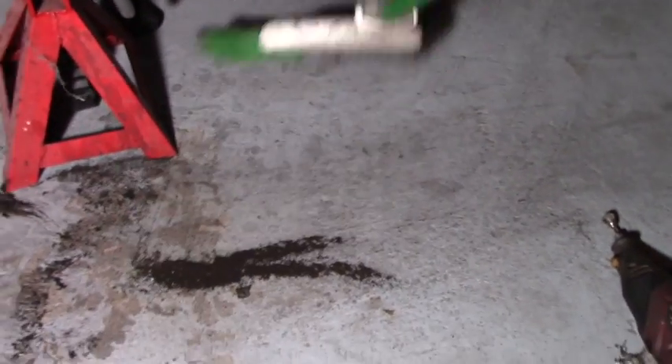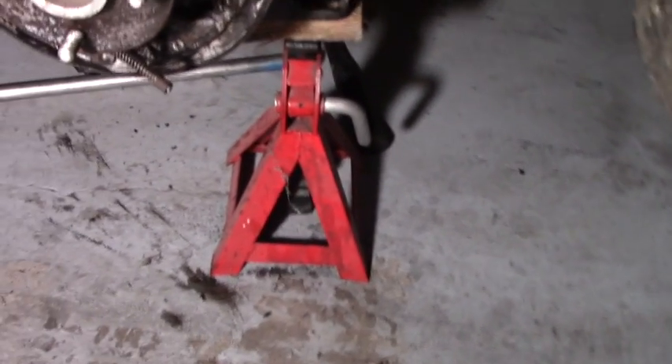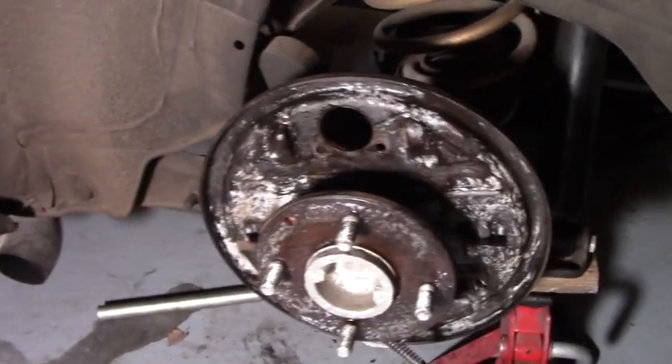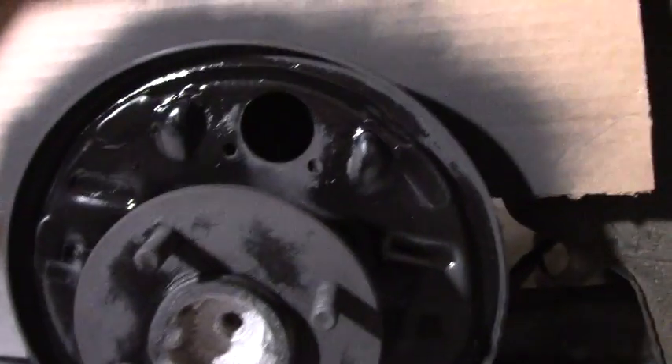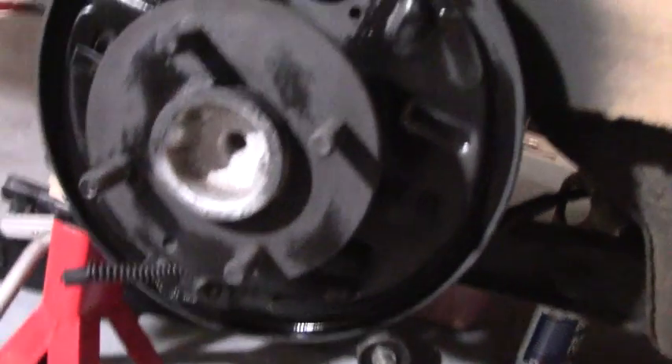Let's sweep the floor and keep the work area clean — I'd rather not be wading in asbestos dust and brake fluid. Look at all this nastiness. Brake lining back in the day was made of asbestos, so there's a high probability that these are asbestos droppings. The rust stuff has really eaten in there, so we'll clean this up, rinse it off, maybe do a little more grinding, and paint them.